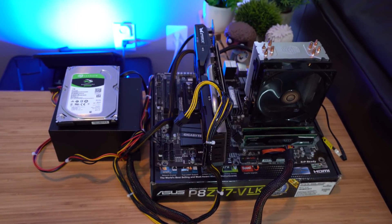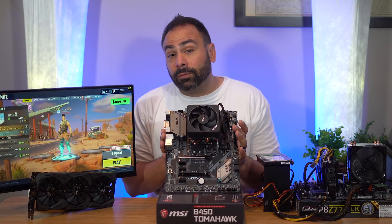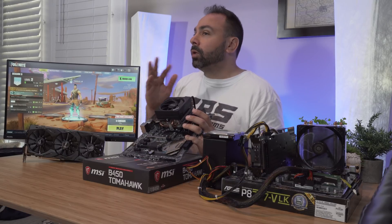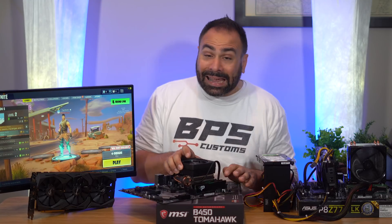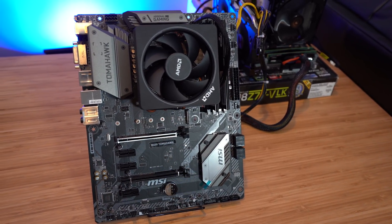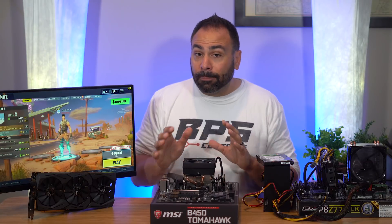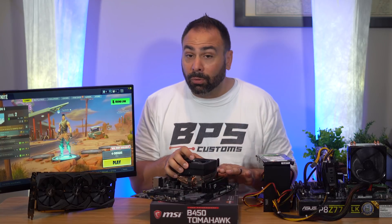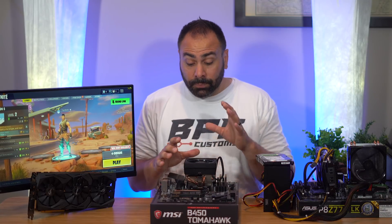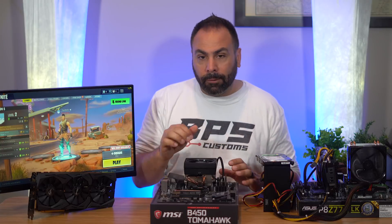The next thing we're going to do is a complete platform upgrade, and this is going to cost you about the same amount of money as a graphics card would. What we have here is the MSI B450 Tomahawk motherboard, a Ryzen 5 2600 — admittedly not with the cooler that comes with it, but we're not overclocking so that doesn't really matter — and 8 gigabytes of RAM. I did consider going to 16 gigs of RAM, but to stay within the $350–$400 price target I wanted a comparable dollar amount between the graphics card and the platform, and that meant going with 8 gigs. However, if you wanted to, you could get a cheaper motherboard or a first-gen Ryzen like the 1600, which would probably allow enough headroom to go up to 16 gigs.